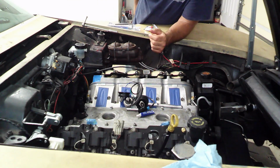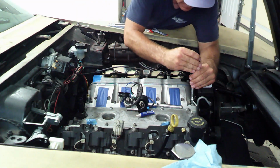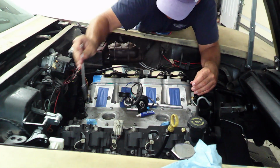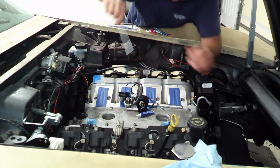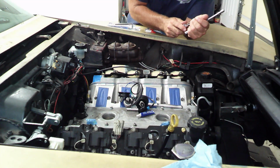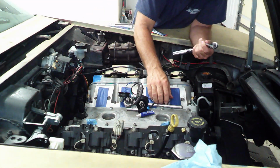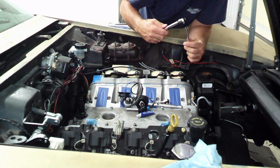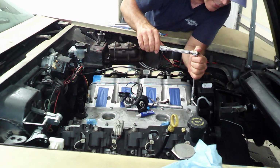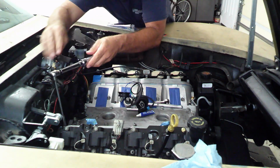Well, that certainly didn't start out the way I planned, but I think we're good now. Went and got the bolts, got a tap. I'm not going to just jump right up to 106 on the torque though. I'm going to kind of feel it out a little bit. I don't think the torque was the issue. I think it was just a matter of those bolts were a little bit on the short side. But I'm going to step it up a little bit and we'll see.